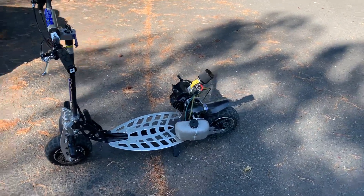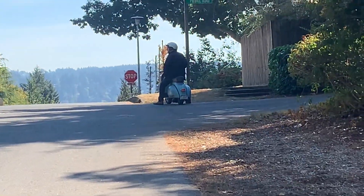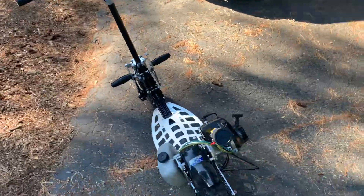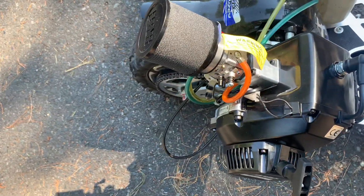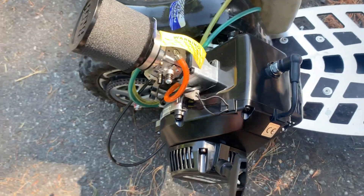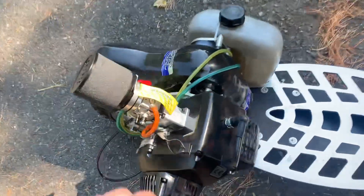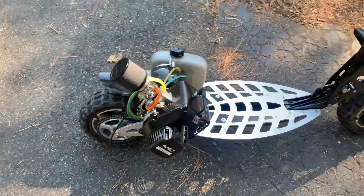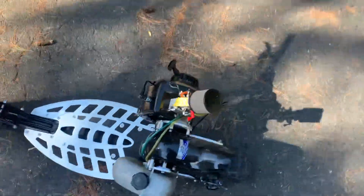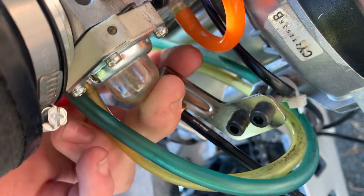I got my Uber scooter — or whatever the fuck it is — over there on Terry on the Vespa, because he wants to go take pictures of the pumpkins and shit down at Albertson's. I just built over the process, maybe about one and a half to two weeks, a six-port GP470 stroker with the Bartolone cylinder. Just got it on, and the clutch might grab a little, so probably have to keep the wheel off the ground. This will be a first start — brand new GP460 carb, nothing's gone through it yet.